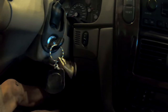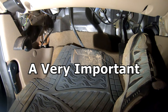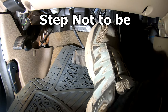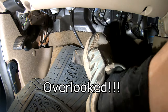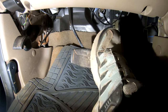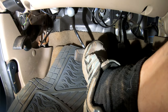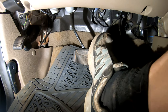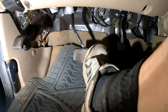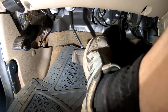Now we're going to hop in the vehicle and fire this up. This is probably even more important than the lug nut step: after you've relined brakes, those pistons are pushed back in the caliper, so when you first push the pedal it's going to the floor. Just gradually keep pumping it and you'll feel it starting to build back up until you get a good solid brake pedal again. You can see it takes a few tries — and I'm pretty much convinced on it. There we have done it. You can pat yourself on the back and treat yourself to a refreshment of your choice.